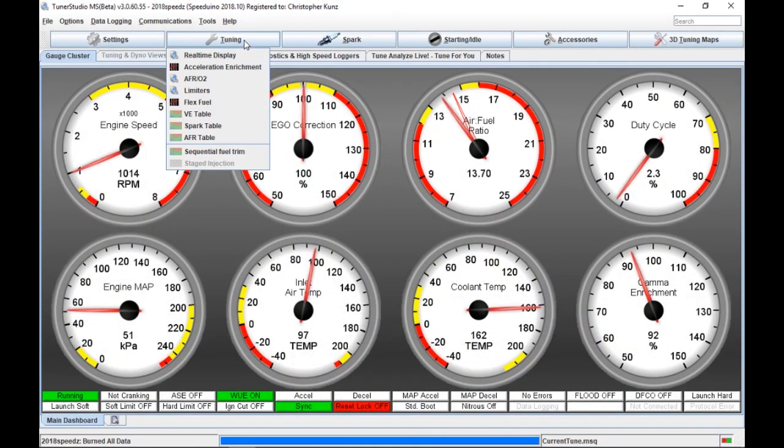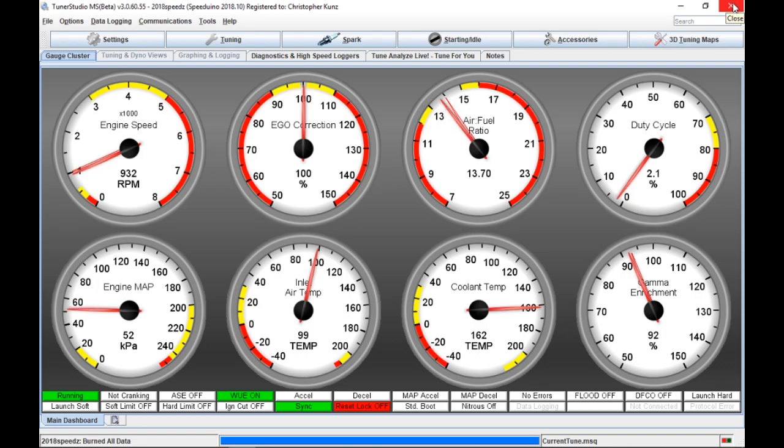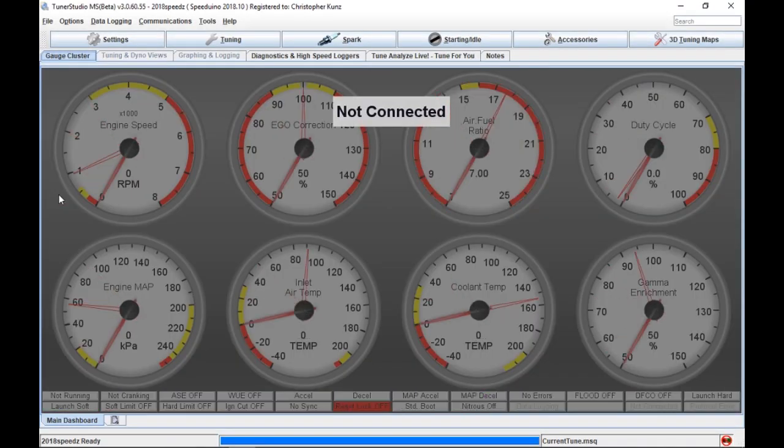So one of the first things I found is that if I start the car and let it warm up to a temperature, the wideband PID settings don't take effect unless I restart the car and it's already over the temperature. So right here in my settings there's a field that says 'active above' and then a temperature — above coolant degrees Fahrenheit. I type in a temperature there, it would go past it and wouldn't start doing anything. As soon as I restarted the car though, it would. So that was kind of goofy to me.